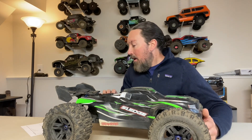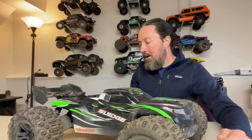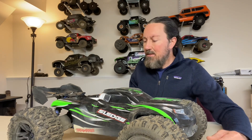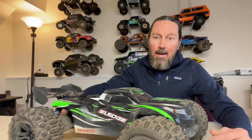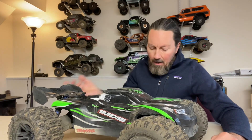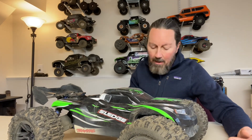I've got a list here that I keep adding to as I learn more. Let's get right into it — I'm going to try to keep this as short as possible. First on the list is a well-known issue by now: the O-rings on the rear out-drive cups. Traxxas will send them to you — the part number is 9680 — or any 10mm O-ring will fit into that rear out-drive cup, just to limit movement on those dog bones and prevent them from popping out.